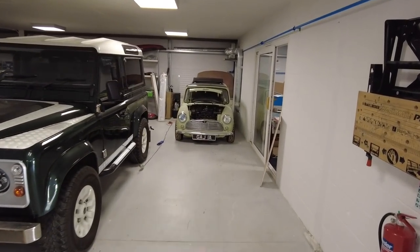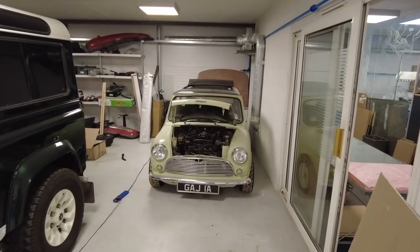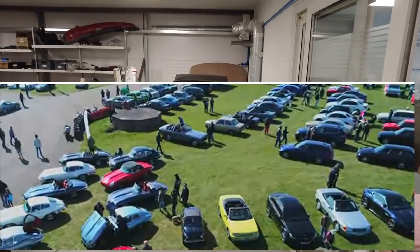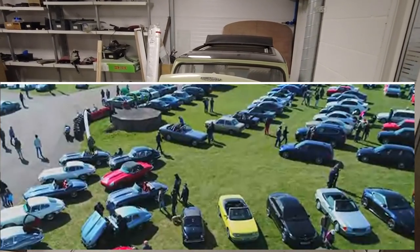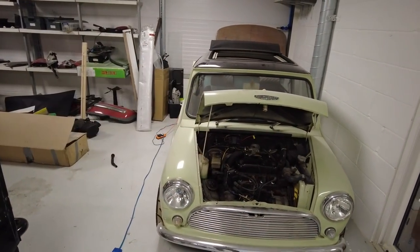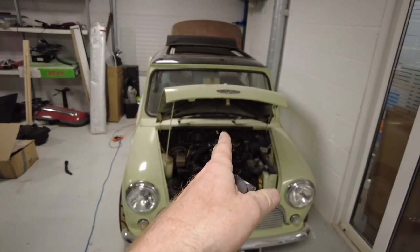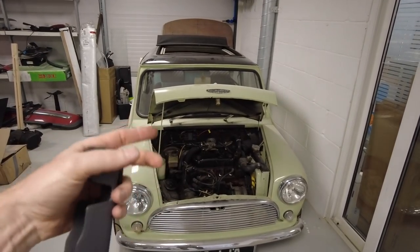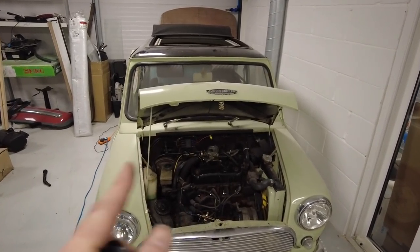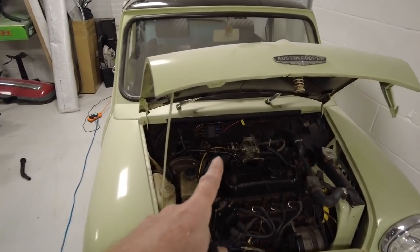We're having a move around. On Sunday we're trying to go to the Bista Sunday scramble and take the old Mini. We've just got it going - Ari's giving me a hand. It was getting no petrol up to it so we had to suck it through. We put a syringe on it - it's got a mechanical fuel pump so it takes a while - we sucked a bit and it's going good now.